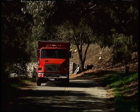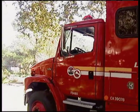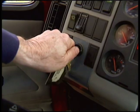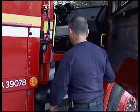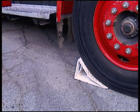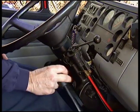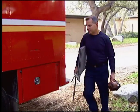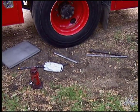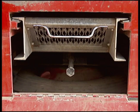Once you realize you have a flat or low tire, pull safely to the right of the roadway out of traffic. If possible, pull off the road completely and find a flat level ground. Set the parking brake, place the manual transmission into reverse, and turn off the ignition. Place the chock block under the wheel on the opposite side of the vehicle on an axle that does not have a flat tire. After placing a chock block on the downhill side, allow the vehicle to gently roll against the chock, then reset the parking brake and transmission. Locate and retrieve the appropriate tire changing tools and hydraulic jack. Some medium trucks carry their own spare tire; if your vehicle is not equipped with a spare tire, contact dispatch or your supervisor.